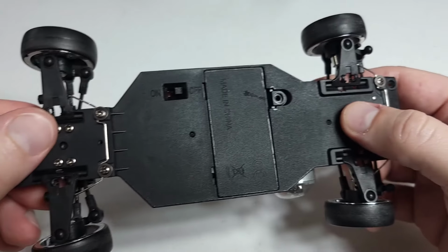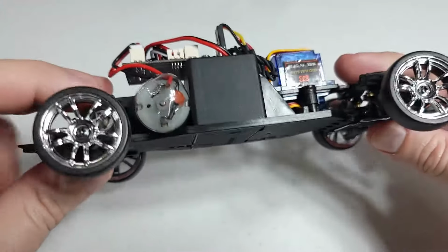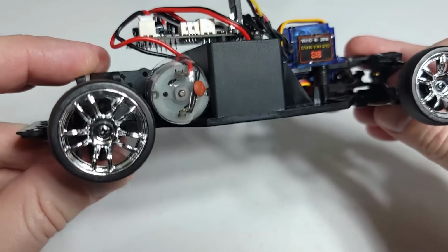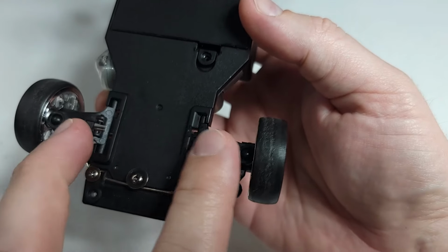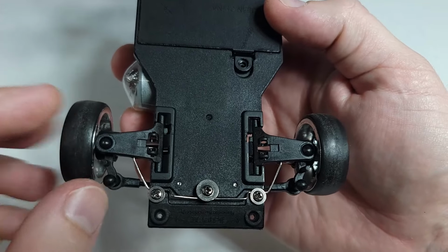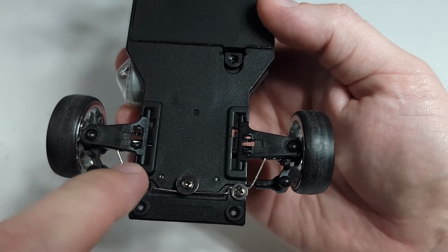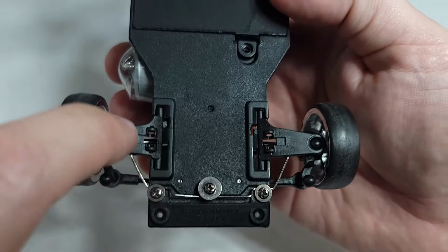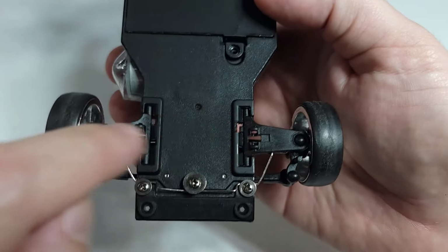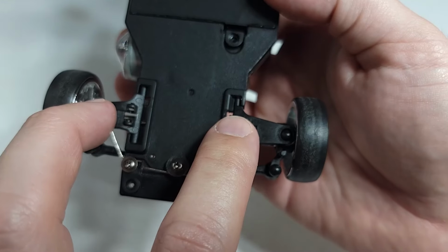And so what I did to fix the suspension, because like I said, once you get it and have the limiters in, it's really stiff and there's no sag. So I had to fix it to where I could get some sag. And what I did for the rear end here was I flipped these swing arms around to give me more caster. So the way that this spring fits into these swing arms is actually different than how it would be from the stock setup. So just be aware of that when I'm talking about this, that these springs will be a little bit further away, because these would actually be the opposite sides. Just a heads up. Go watch my other video on caster and I explain that in more detail.